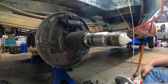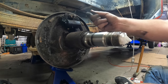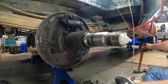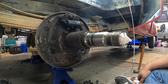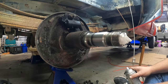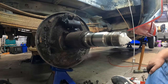We've got all the brake stuff out of the way for the most part. Still got to drop this wheel cylinder out. On the driver's side the brake line was seized to the inside of the fitting, so it actually twisted the line off - I've got to fix the line on that end. Hopefully this side won't be as bad. I went ahead and shot it with some Freeze-All to loosen it up. We'll shoot a little more on the back side and see what happens with our brake line - and I think this one's actually going to play nice.